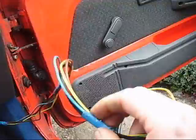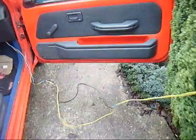Where one ends, I put some tape, and then right on the very end, because it's the last one. So basically, if I pull this, you see what I mean. You just get one big long wire. Then on the end is some welding wire, which I fed from the top down until it poked out the bottom. Then you just pull it all through.